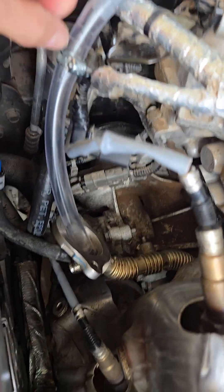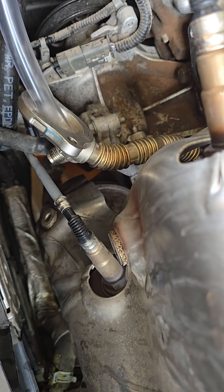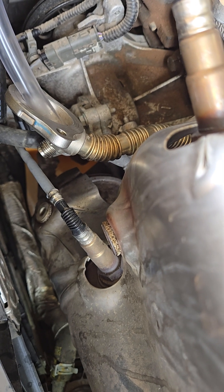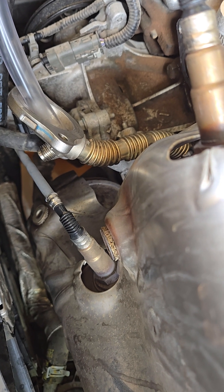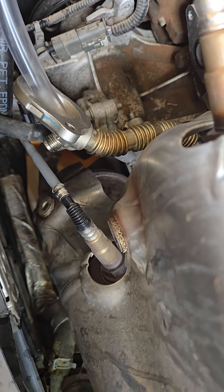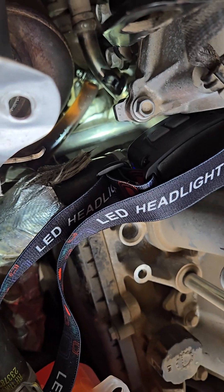The reason the clamp is still on is because before I took off the clean EGR cooler, I went through here using a gallon of purple power — about eight to ten ounces — let it sit, sucked it up, let it sit again. Then I used a gallon of distilled water to rinse it out, but I wish I'd had vinegar. This time I made sure I had cleaning vinegar to neutralize it.